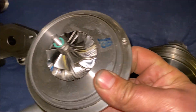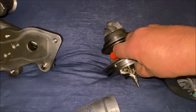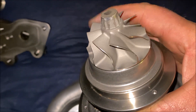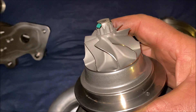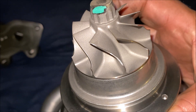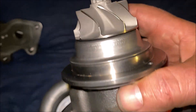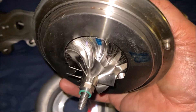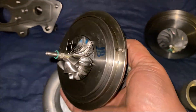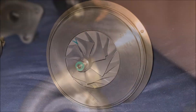This small one is basically the same size as a K04 from an A180, so it's good for about 300 horsepower — but it's way better than a K04 because it's basically got EFR wheels. It's got the full-back turbine blades which is an EFR thing. What they're made of I don't know — maybe gamma-ti like the EFRs; they feel light. It's got the full-back blades where the bottom of the wheel goes all the way to the edge — look at almost any other turbine wheel and they're not like that. It also has the fancy billet compressor, the EFR blade shape. It's good for maybe about 300, but that doesn't really matter because the small turbo's job is mostly to spool up fast and spool the big one.